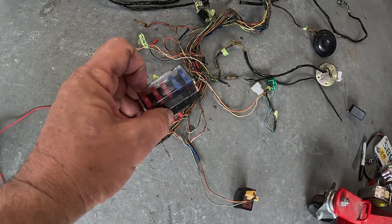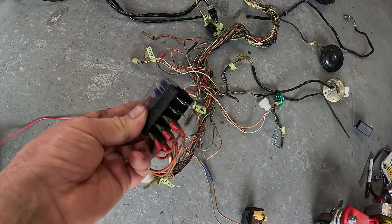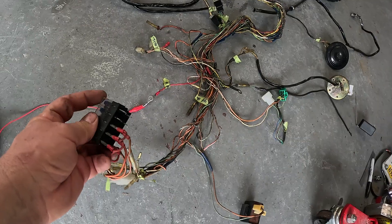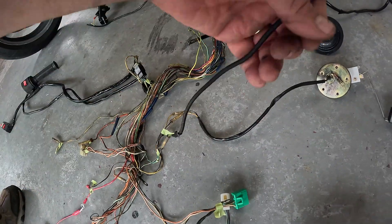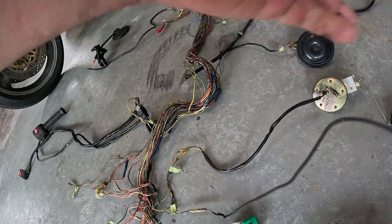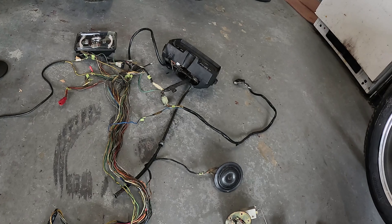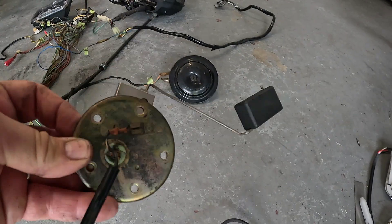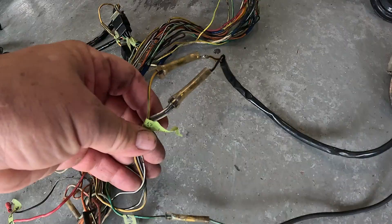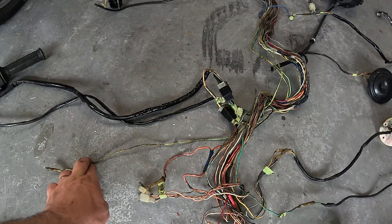We're keeping the fuse box obviously. You can use those two fuse positions between the power input and the red wire going to the key to protect the system — even at 96 or 72 volts, the fuse is based on amps and will still work. If you have wires going to the engine, they'll be a temperature sensor or oil pressure sensor — get rid of those, you'll never use them. There's also a gas tank sensor that tells you the gas level — just a ground and signal wire. Mark it and throw it away.